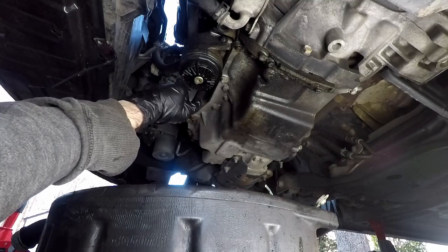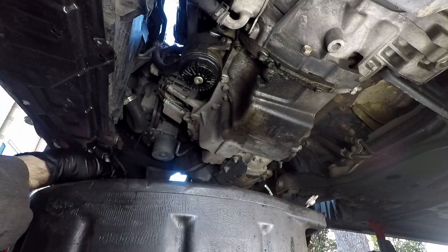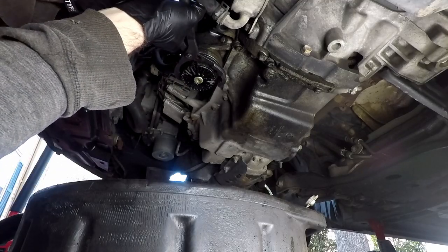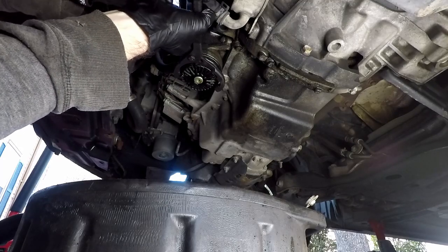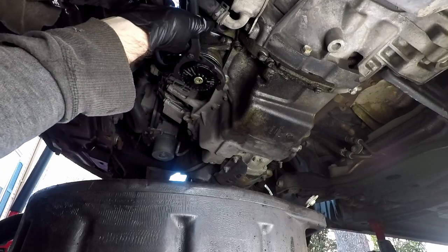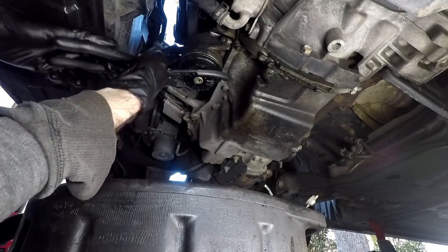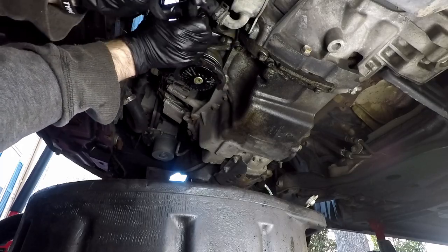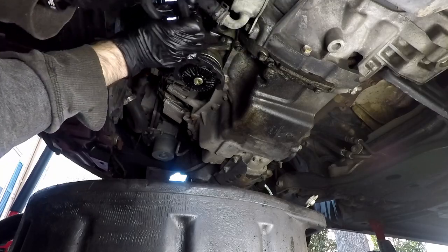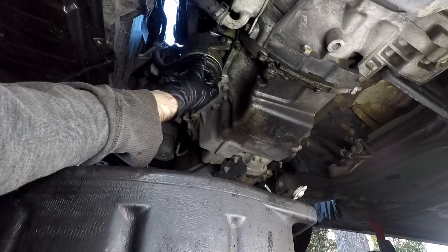There's an Allen head here you can use to pull the plug and drain the oil, but apparently it's metric and I just bought a set of SAE Allens and I can't find my metric ones. So we're just going to pull the cartridge off the housing using these pliers — basic oil filter wrench pliers. I loosened it before I started filming to make sure I could get it off with this tool. I've used this for pretty much all my oil changes except once on a Dakota truck where I had to use a screwdriver and a hammer.